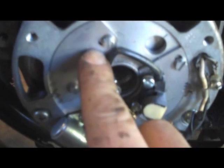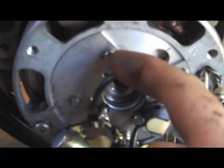There's another issue with the kit - it comes with screws but no washers. I use the old washers off my breaker assembly because they keep the bolt from protruding into that plate. Always check that things spin free - the first time I tightened it up, the screw was actually going in and keeping the engine from turning over. For these shims, you'll pick the right shim from your kit to get the photo eye the correct distance from the rotating breaker. The shim has to be modified - just sand a little bit off the back corner so you can get the screw in, and everything should work fine.